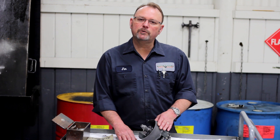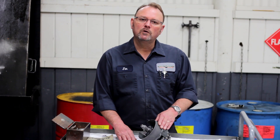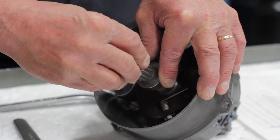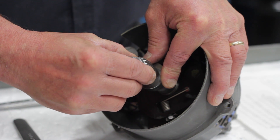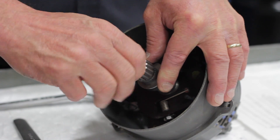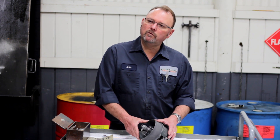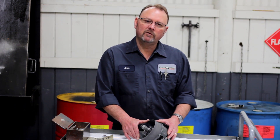If you find your distributor timing to be off — for example, 16 to 17 degrees — you can refer to your timing chart. Loosen up the distributor drive nut; the chart indicates move four left, one right. After you've done so, retighten your distributor drive nut up to the torque point at your cotter keyhole. Then reinstall it in the engine at 21 degrees and go through the timing process one more time.